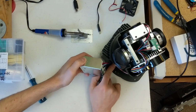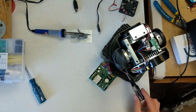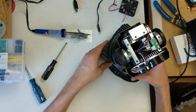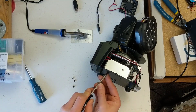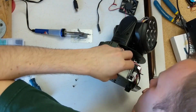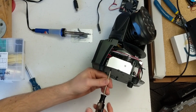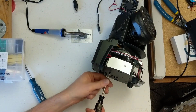We'll go ahead and put that power supply and those other goodies back in because I had to pull that out. So I'm literally fishing my wire through so I can plug it in on that board. Boom. Now we're going to pop that board back in, tip the light over, line up the screws, and screw those in. After that, the very last step is just to put the cover back on the outside of the light. Pretty simple. Don't forget, of course, to re-plug in the display.